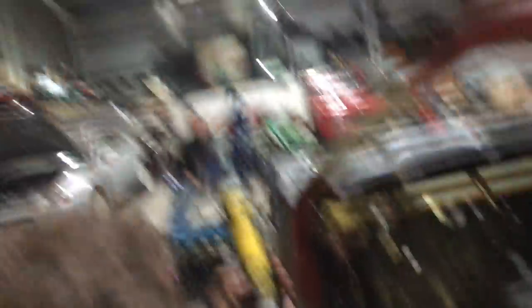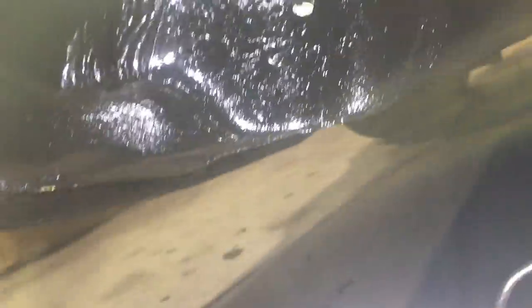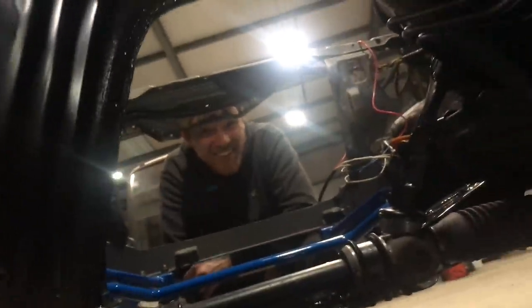On the Japanese 86, the charcoal breather goes all the way back up to the front, but we're going UK spec with the car, so we're going to vent it from the back. We've got the fun job of ripping it off from underneath because we're also fitting the gearbox. The UK spec breather doesn't route to the front, so we're cutting it off at the back with a pipe cutter — tighten it in and we're done.